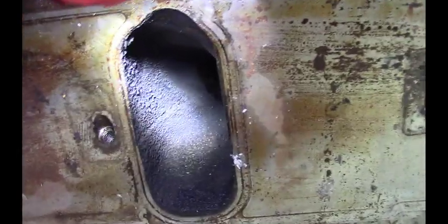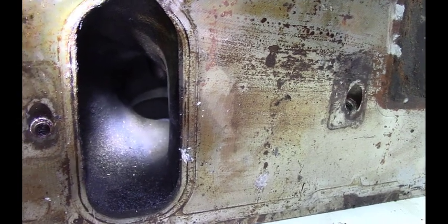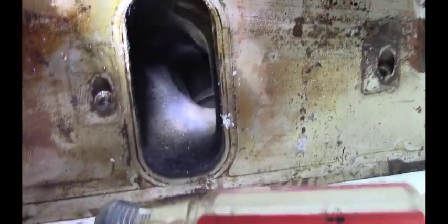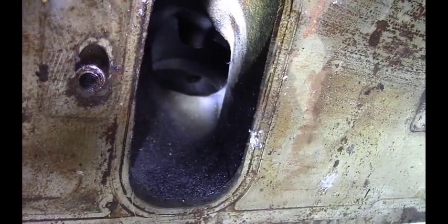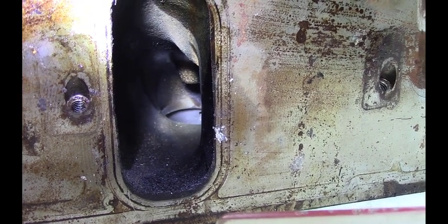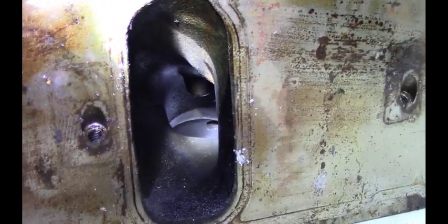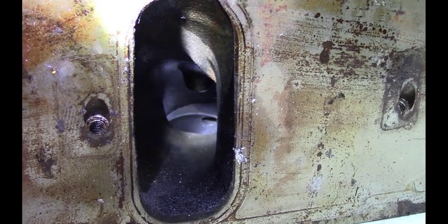Looking on this wall, there's a nice sweeping flow into the valve throat and on the floor of the intake port, so I'm not sure that's going to require a whole lot of work. And then on the side of the port, the casting's pretty good for a stock casting, considering older big block cylinder heads. Deep in there is the valve guide boss as well, but we could probably clean this thing up and get some flow out of it. So let's have this thing flowed stock and then do some porting to it and see what a little bit of hot rodding can do to this 8.1 cylinder head.